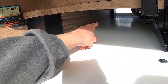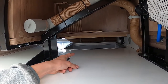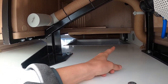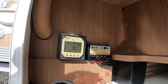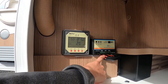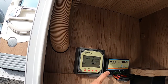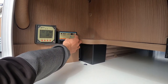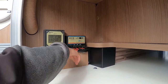You've also got your hatch in the middle of the floor, which accesses that gully there for more storage. You've got your frost control Truma in the corner, which I'll show you from inside. You have your solar regulator and battery charger — this is a dual unit, so it's charging two batteries: the engine and the habitation/leisure battery. It's showing 50/50 on the meter. Press here to prioritise one battery over the other — you can put it all into the engine battery or all into the leisure.